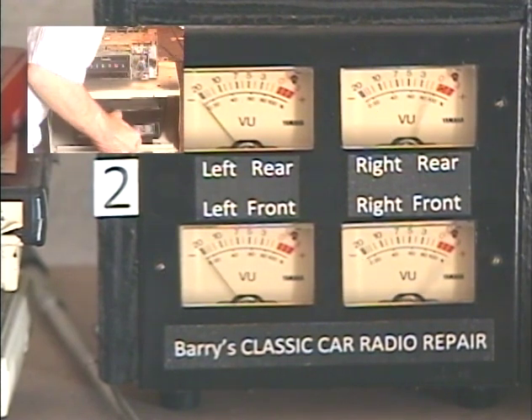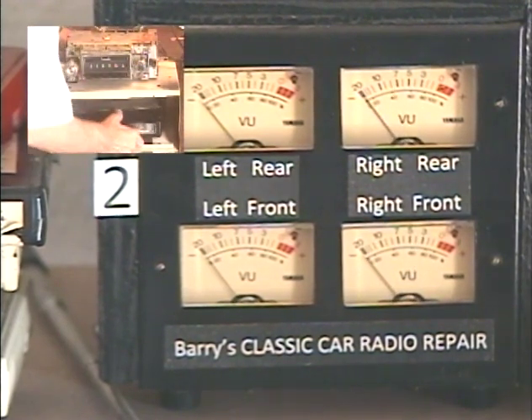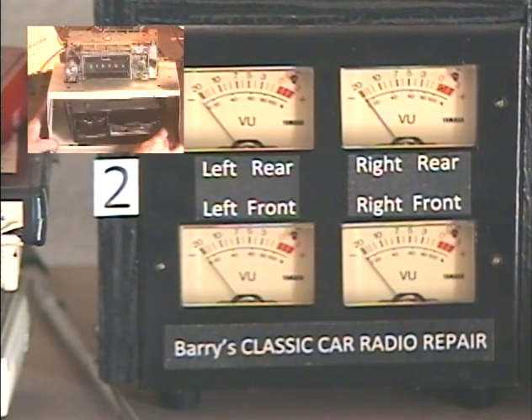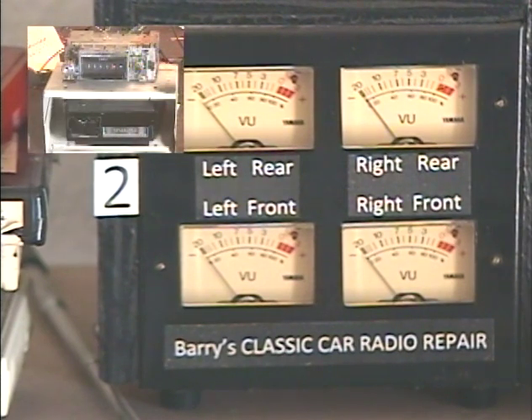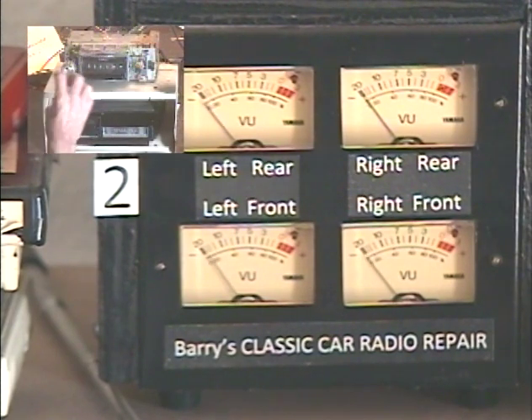One side, other side. So after using the aux input, there is a 20-second delay before the radio comes back. That's because of a VOX circuit — a voice-operated switch — that holds on to the aux signal a little longer than needed, just to make sure it's not constantly switching back and forth between the radio and your MP3 player between songs. If you don't like the delay, just turn the radio off and right back on, and it'll work immediately again.